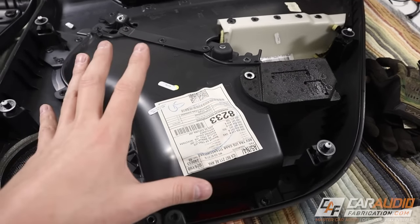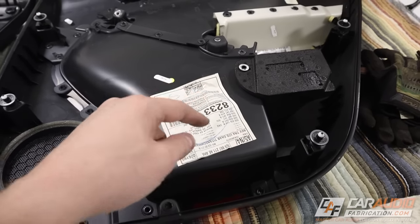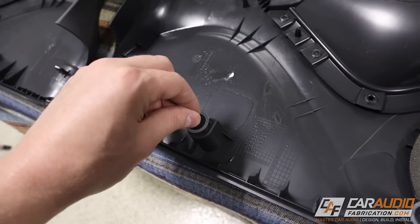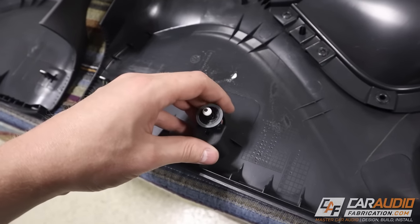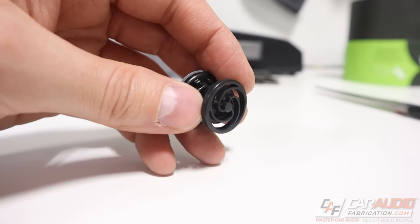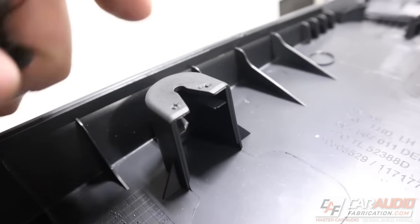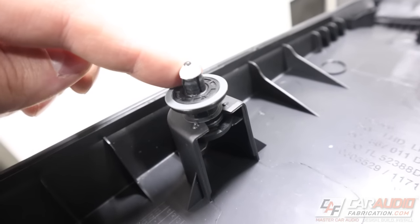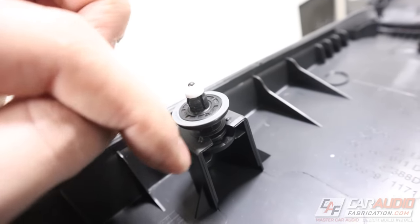The first thing that's got to go are the stickers put on in the factory — they're only half stuck on and are nothing but a source of potential issues, so they've got to go. Next I address the clips. Usually on a lot of vehicles when you move these they can make a vibration noise, so I'll pop them out and wrap a very small amount of cloth tape around them and put them back in — that gives enough resistance so they can no longer vibrate. These particular clips have a nice spring design that keeps them tight so they don't vibrate, so these are actually fine without any modification.